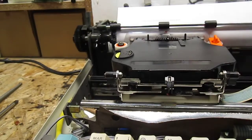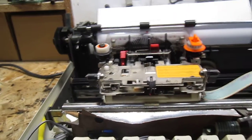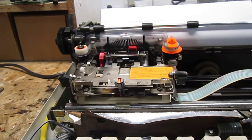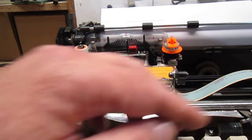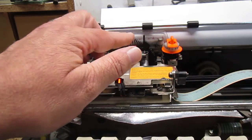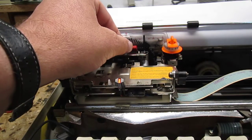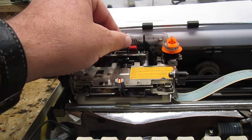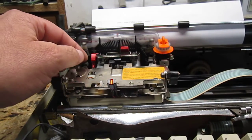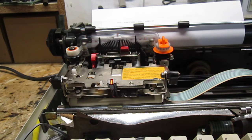Now I'll try and show you again — I'll get this ribbon out of here, so I'll put this on again. She's actually turning and spinning properly now; she wasn't before because of that control cable. But it's still not aligned, and that's pushing right through. So what we've got to do is align that hammer. I've got to figure out how to do that — I don't have the alignment procedure here, but I'm going to have to wing it. We're going to have to get that lined up properly.